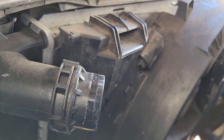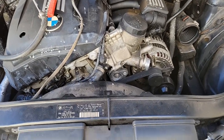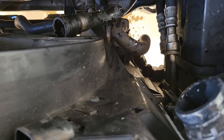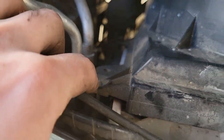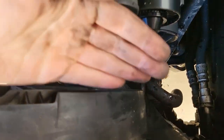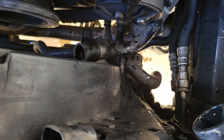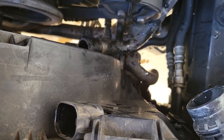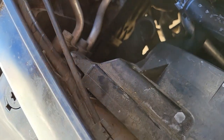From here we're going to be taking off the actual electric fan. I'll show you where all the bolts are. For the most part this is held on by just being slid into place, but there are a couple connection points. There is a T25 here and then there's also one on the bottom. You'll likely have a plastic skid plate underneath, and for the most part you're removing every one of those bolts that you find because they pretty much all hold that plastic bit on.